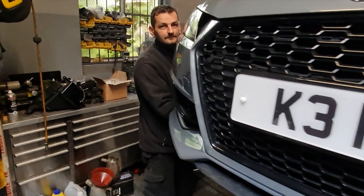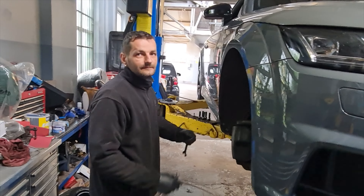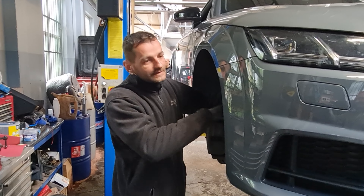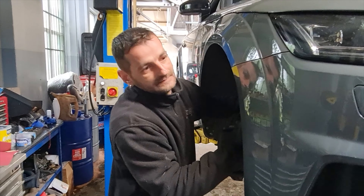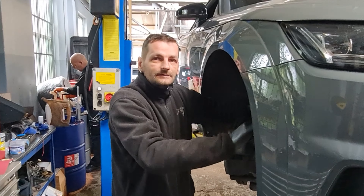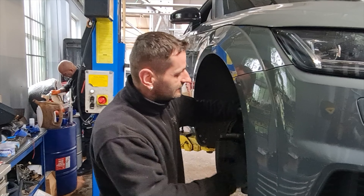So Michael, do you have to disable the parking brake when you bleed the rears? It's good to disable — yeah, some car models we have to check it. And you need to plug in the diagnostic computer and bleed with the diagnostic computer. That's what I've heard — we'll see how it goes later.